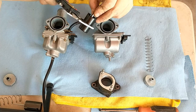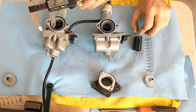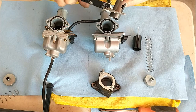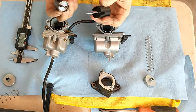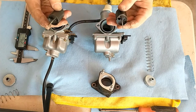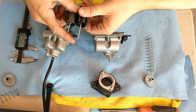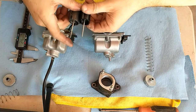This is the needle from the Amazon special, and this is 24 millimeters near as damn it. And this one is exactly the same — 23.98. The needles look somewhat similar, although this one, interestingly, is longer and pointier than this one. This one is longer and has a shallower taper, while this one seems to have a more aggressive taper.